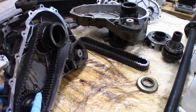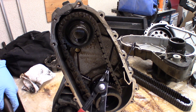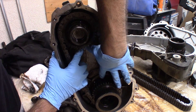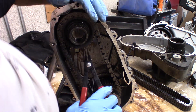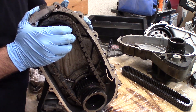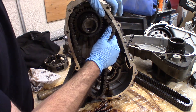This is the part I'm after — I need to get this out of here. I'm using these circlip pliers — lock ring pliers — just to make things a little easier. You don't absolutely have to. If you have two people, this is not a very strong spring. You can bend it apart with even one hand. Just to make it easier since I have the tool, I'm going to use it. That's one easy way to get the chain off. This is kind of loose — it's not attached to anything.